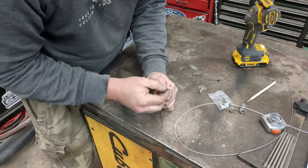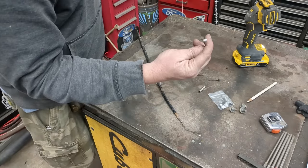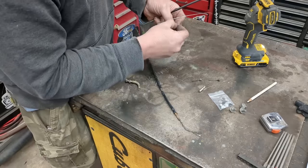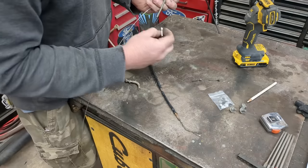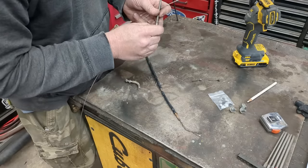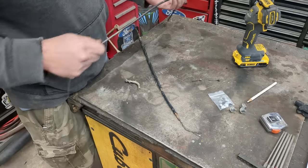Use a zip wheel to cut it. If you try to use pliers or something you're just going to crimp and smash it. One end for this cable is already on there — I already have the barrel I need, and it looks exactly the same size with just a little bit of flashing on there I could sand up. I'll put one ferrule on — these are kind of loose; I could smash it a little bit or put some epoxy in there, but for the most part it's going to hold itself on.